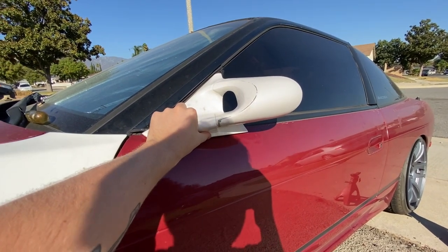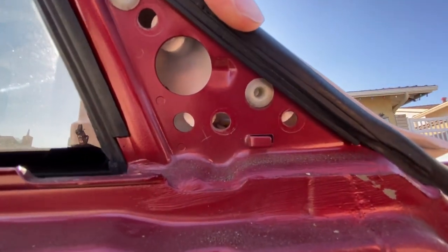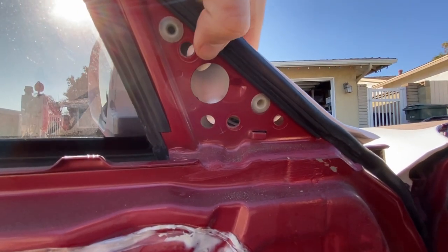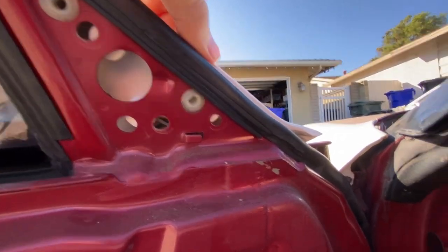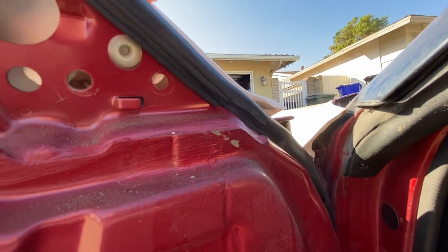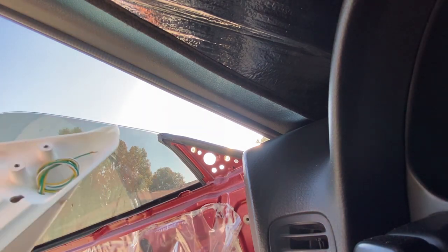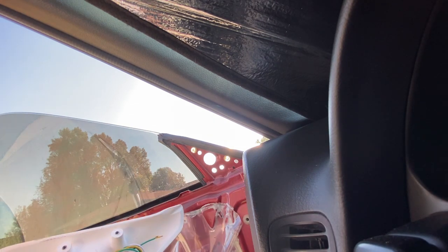As for the holes on the inside, I'm going to open the door now and we'll see where the holes line up. Here on the back side, you can see these holes do not line up whatsoever. We got one hole here, one down at the bottom, and one over here — they're all covered by the metal of the door. So what I'm going to do is mark this where the holes should be, drill holes in the metal of the door, and literally just put some bolts on it. I can already tell that this little corner down here I'm going to have to trim off, but with some 80 grit sandpaper it should sand right down. I got myself a Sharpie, so I'm going to put the mirror where I want it and start marking some holes back here where I'm going to be drilling.